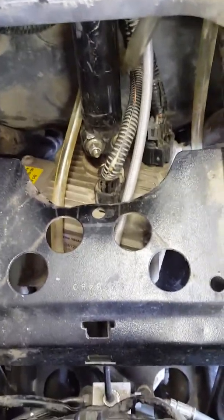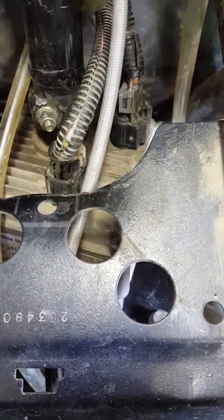Like I said in the other video, you have to take everything apart. I did this this morning. The power steering unit went in fairly decent today. You do the bottom first — just lay everything loose first on the plate. Just leave them loose. The tank will be out so you can get that one bolt that's all the way in the back, but leave everything loose.